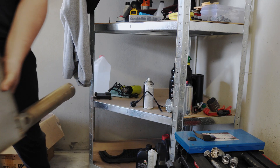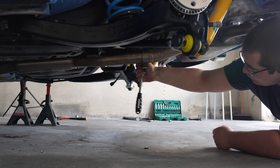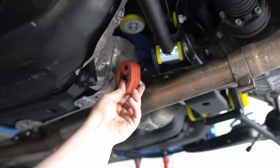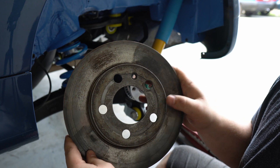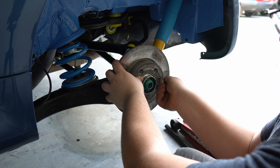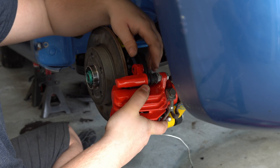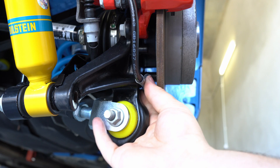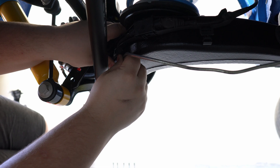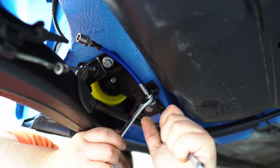I was very glad that all I had to do with the exhaust system was to remove the cat and install it back, as to be honest it's not my favorite kind of job. And it is the same about the brakes. Fortunately in my case they were replaced brand new recently so it went flawlessly. Calipers take only two bolts to mount them in, so that's very easy as well. But please don't underestimate this part of the job — pay extra attention to all of the brake lines so they are installed properly, and don't look for savings there as this is the only thing that keeps you safe.